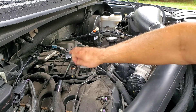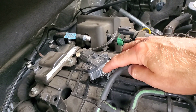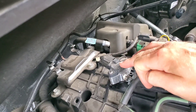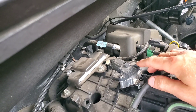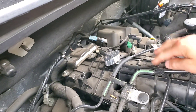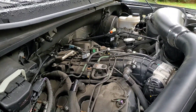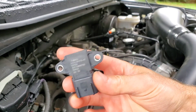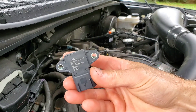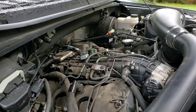This is where that sensor is located right here. Mine's a little bit different — that's my boost reference for the blow-off valve, in case you guys didn't see my other videos. The MAP sensor — which stands for Manifold Absolute Pressure — sits right here, after the throttle body in the manifold, so you can get that accurate reading for boost pressure. This is a Ford Motorcraft product. I believe these come on the Ford Raptors because they run a little more boost with the high output engines.